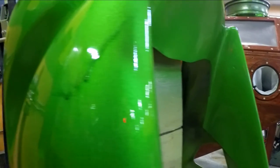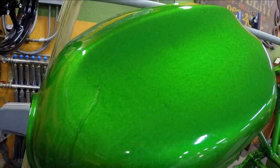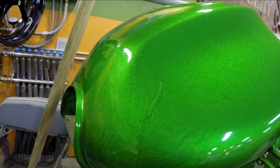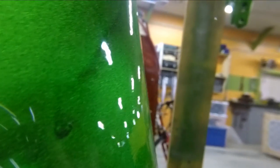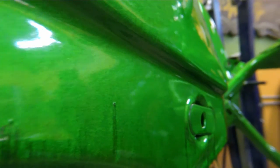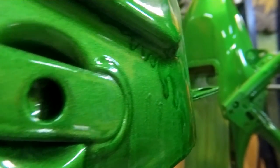The paint I decided to go with was a single-stage urethane with some metal flake or metallic to it. I found that this paint was difficult to lay compared to a two-stage paint — there was a very fine line between getting it too wet and not wet enough. If you didn't get it wet enough, it orange-peeled extremely easily, and if you got it too wet, you would start to get drips and sags. I wouldn't recommend this paint for a beginner. I'm a beginner — I got frustrated, but I stuck with it. There are a few points in the video I didn't include, such as having to wet sand and repair some of my mess-ups. Some of my mess-ups I'm just going to have to live with. If you like what you've seen today, please subscribe and we'll see you next week.